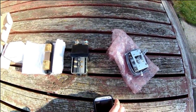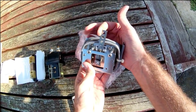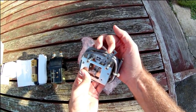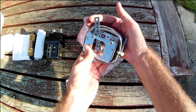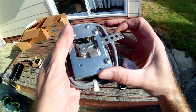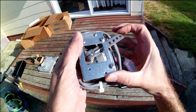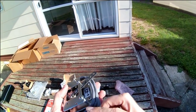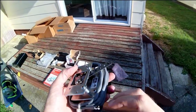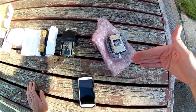We're starting to lose daylight, so — this is a throttle, Curtis again. It's basically just a large potentiometer with a heavy spring in it, quite strong because you're going to be pushing it with your foot. It's not just a potentiometer though — there's also a switch. When you get right to the bottom of the pot's range, it completely cuts the connection altogether, so instead of a high resistance you get absolutely no connection at all. That's just for safety — when you take your foot off the throttle, it's not going to be interpreted as moving slowly.